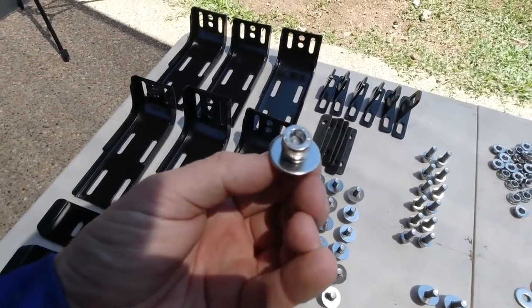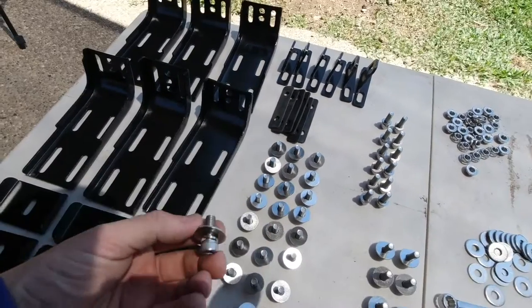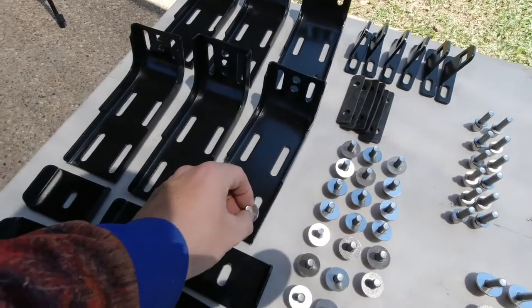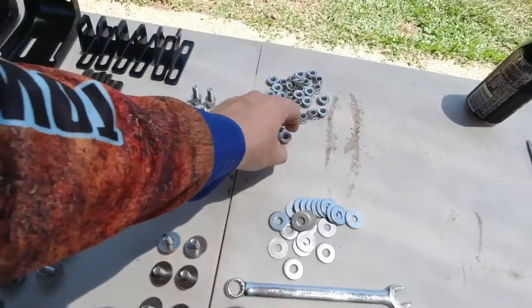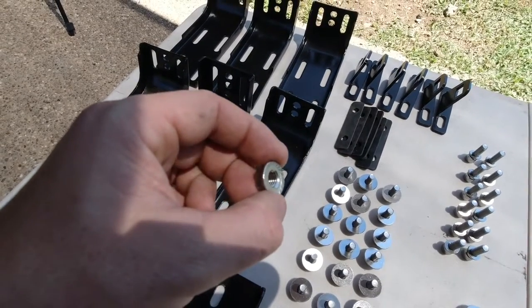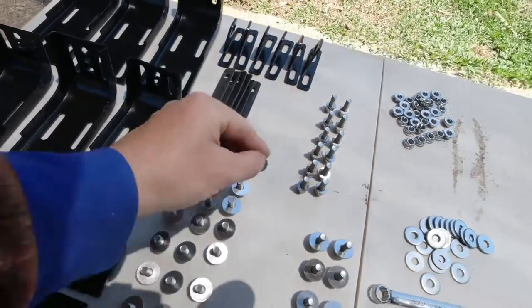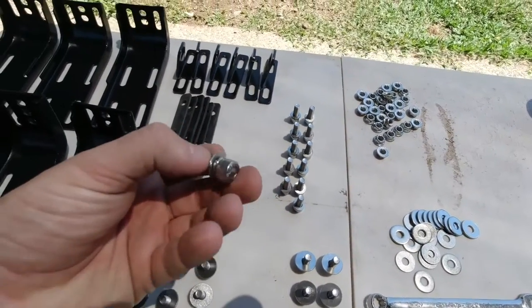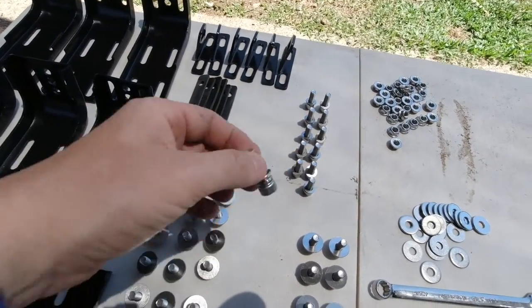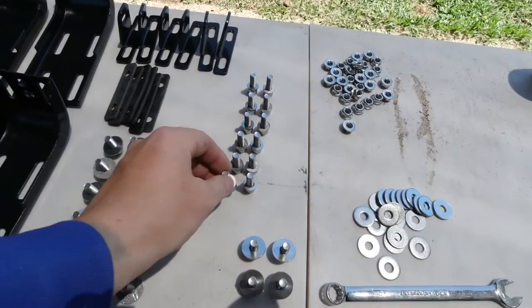Welcome back. Today I'm doing a run through some specs and an install — it's an aluminium flat rack from OCam 4x4. All the fasteners look to be stainless steel. The shorter ones, I think they're 15mm, use a spring washer and flat washer and go through these brackets here with a nut on the back — a lock nut type arrangement that bites and grips.